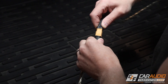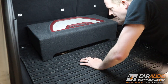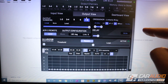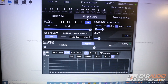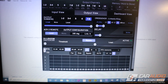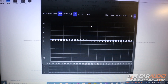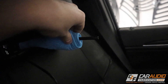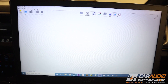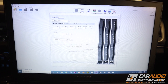We've got the enclosure sitting in the vehicle. Obviously if we were driving we'd want it mounted, but for now we're just doing quick testing to see the performance. Inside the vehicle, I've connected my laptop to the DSP that is sending the signal to our amplifiers. I'm on the subwoofer channel number 10, and with the equalizer open you can see I don't have any EQ applied whatsoever. I also have a microphone at the listening position at the headrest, and I'm going to use Room EQ Wizard (REW) to run a quick sweep to test the frequency response.